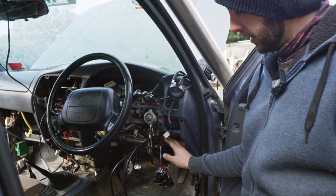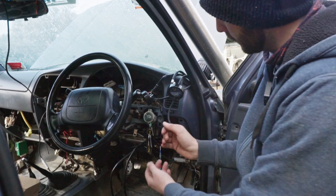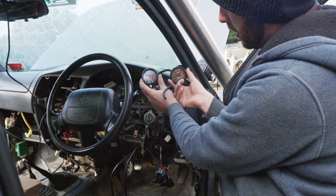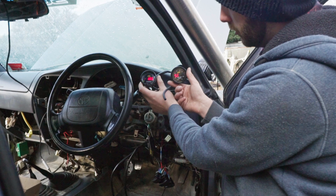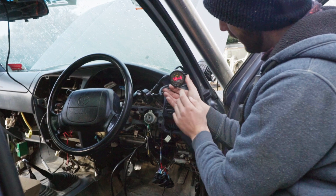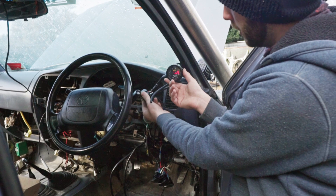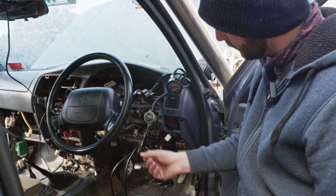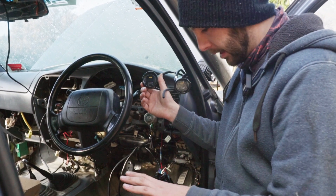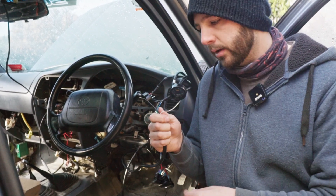The positives are lit now. I've just attached the negatives down in my bank to check everything is going. This means we can now check that our sensors are actually going to turn on — and they are. It's currently reading negative 1.8 psi outside. It's telling me 'sensor' because my wideband sensor isn't plugged in yet, but my gauge is turned on fine and dandy — that's what we want to see. Boost is pretty much done: boost control is in, solenoid's in, true boost units, all done and dusted. All we need to do is wire up that negative.